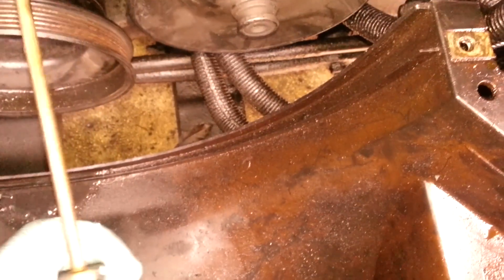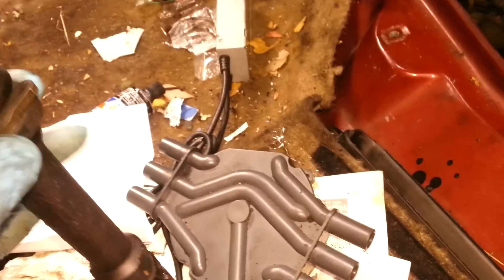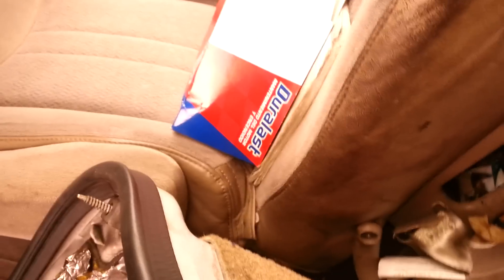Then I did the distributor, and that's another thing I couldn't find how to do. The reason I had to replace it was because my distributor stripped out. I tried JB Weld — bad idea. Also the shaft was bad, it didn't rotate freely on the old one but this new one did. I got a cheap one at the junkyard for 30 bucks with the igniter.